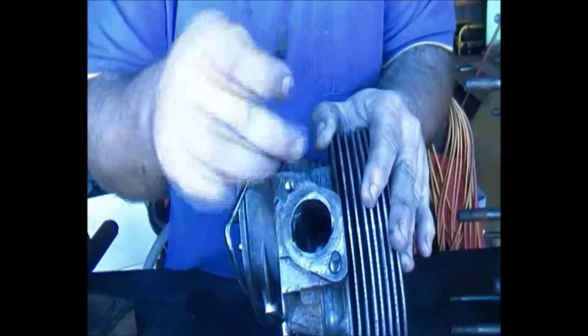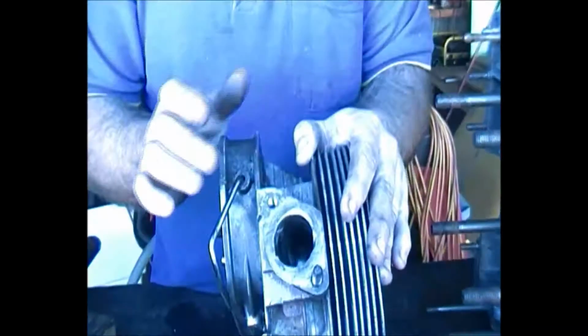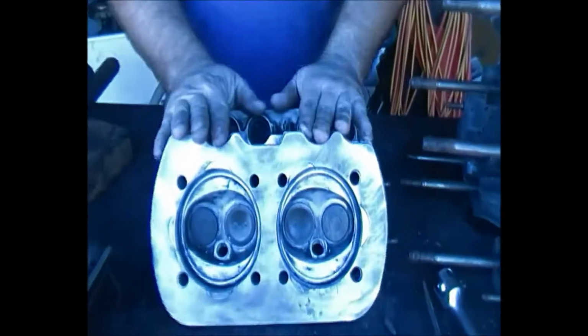And of course, this stud, which was in this hole, just came out with a stud removal tool, which made it very nice. So pretty much we're at the point now with these heads, we will probably just, in the next video, bang the springs and collets on them. These heads will then be done, and then we'll be back to the block. And that'll be probably video sort of 6 or 7.